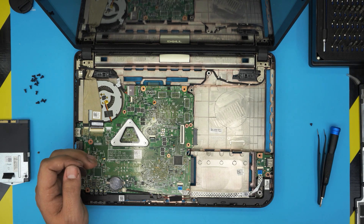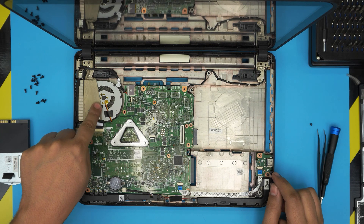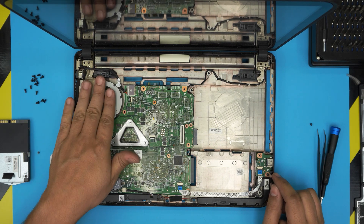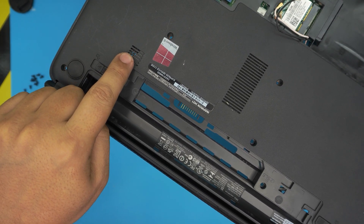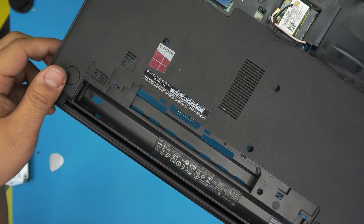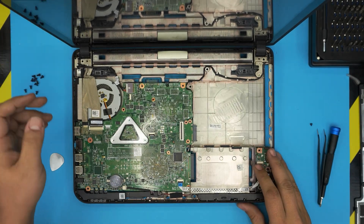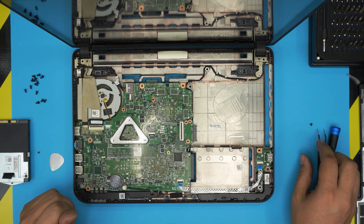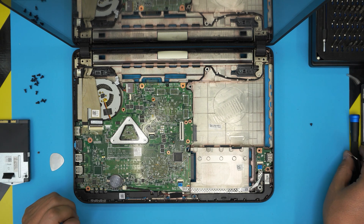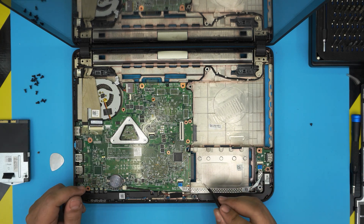You can go ahead and clean up the palm rest with a toothbrush. Down here we have the fan — you can see it's already covered by the flex cable. The intake is covered by the palm rest, and on the bottom side the airflow space is tiny. This is really bad airflow, done on purpose, so after a few years it starts overheating and can damage the motherboard.